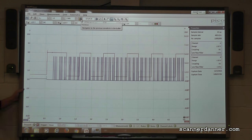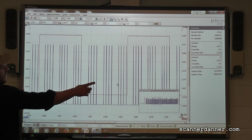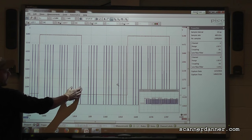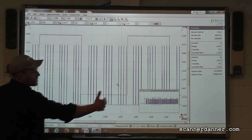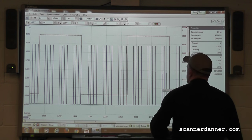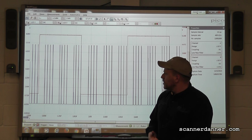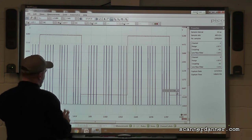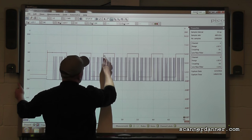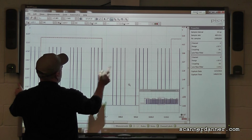What do you guys think? We've got our repetition - much cleaner signal. I wanted to have at least two rotations of the cam. You can see the groupings of four - four, four, and four - that's 360 degrees. Then four, four, and four - there's the next 360. The blue is the crank and the red is the cam. We want 720 degrees total. I'll pull in 720, but these relationships look off to me.